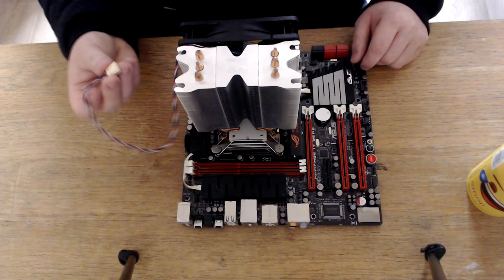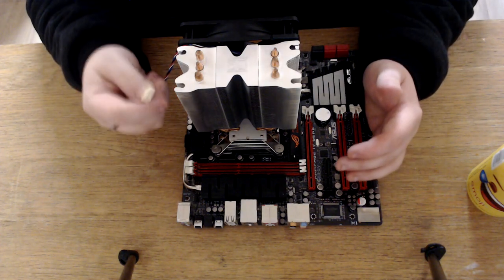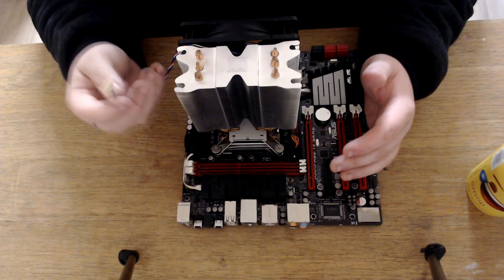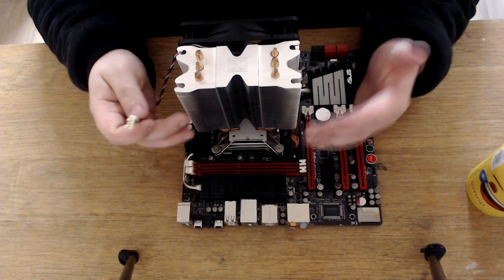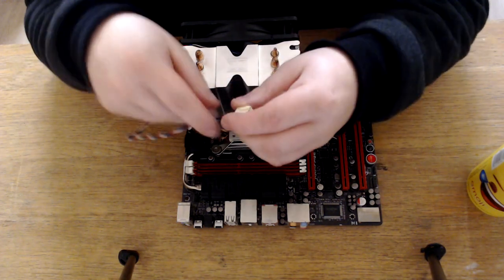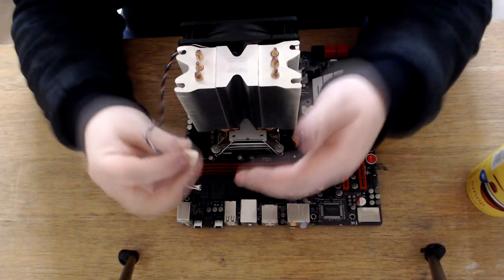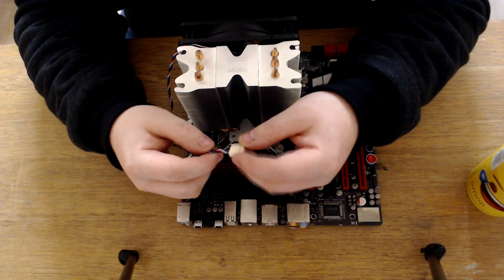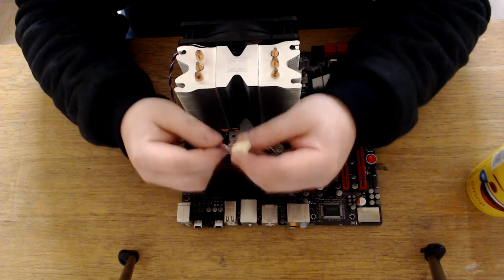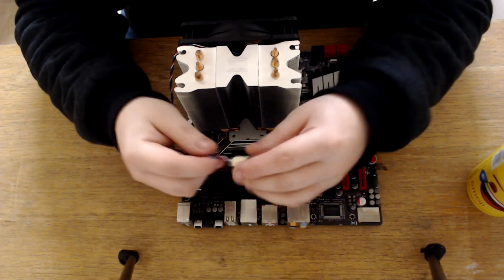And then all I'm going to do is take this CPU fan header. Well, you could technically plug this into any motherboard socket, and it would work off any. But the correct way you want to do is just put this into the CPU fan header, because this controls the speed. And when your CPU temperature rises, you want it to do it correctly. So you want this relay to do it right. You want this in the CPU fan header. I'm just saying that technically, if there are any newbies out there building PCs, don't put this in any fan header, put this in the CPU fan header. It will work in any, but put it in the CPU fan header.